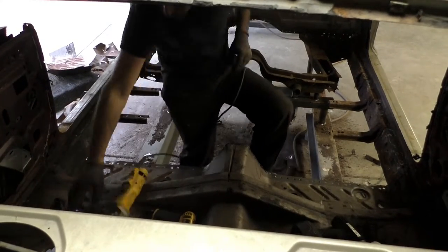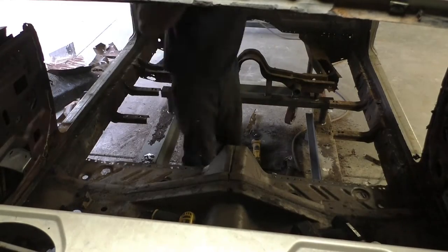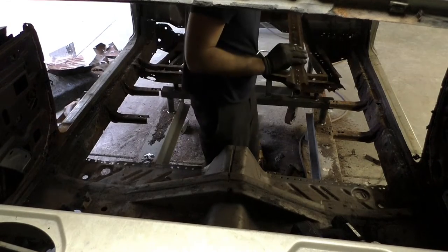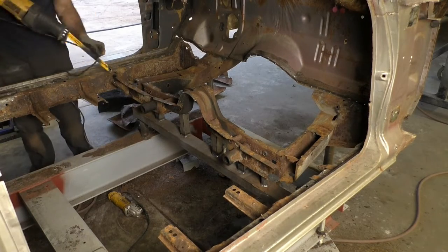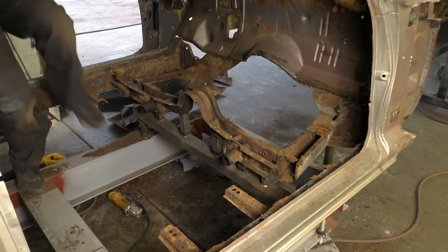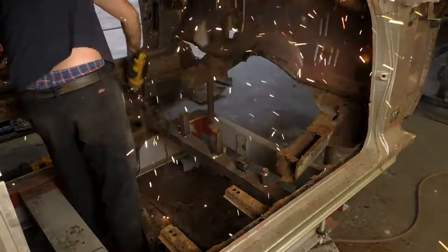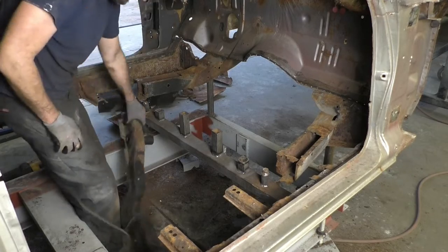Now I have to take the cutoff wheel because the factory couldn't get the spot welder on this angle back here, so you're going to have a factory stitch weld — basically a lap joint with little two-inch stitches in there. Take a look at how rusted this piece is. These are the two areas in the joints between the floor pans. The reason I'm showing you this: your car may only see a little bit of rust on the surface, but that's the tip of the iceberg. Every panel on this car that's joined together probably looks like that. There wasn't proper rust prevention between these panels when they were welded. If you're looking at buying one of these cars, just be aware — the rust you see is the tip of the iceberg and it gets worse and worse.